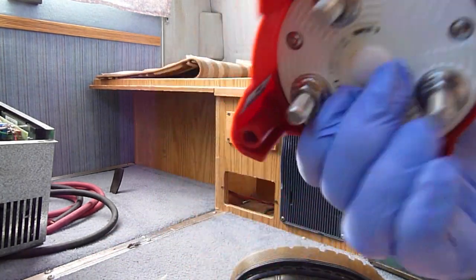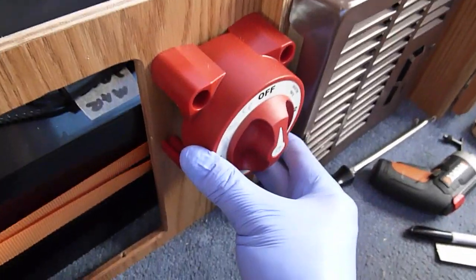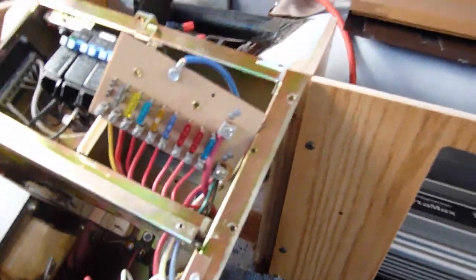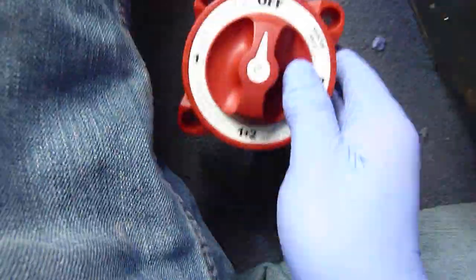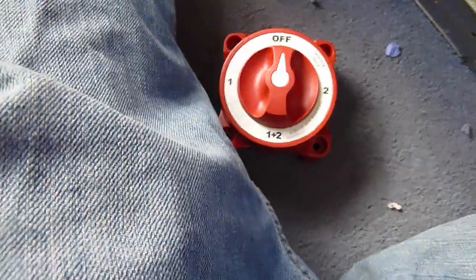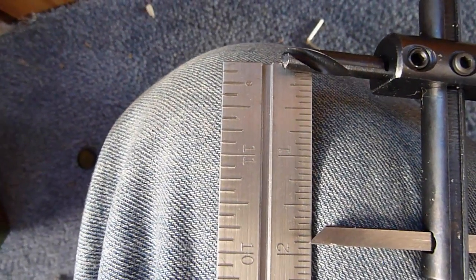But this switch can be mounted either on the surface, just like this, or, if you drill a big enough hole, it could be mounted with this part on the inside. My hosts were kind enough to take me to the local Ace Hardware, and I was able to score a hole cutter. This requires, what was it, a 3 5/8 hole. It was something like that. But I wound up splitting that in half because this actually does a radius cut. 1 13/16 radius. So that's what you need if you get one of these switches. I cut it just slightly larger.